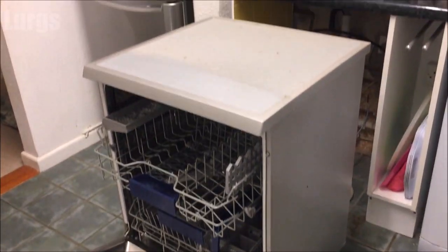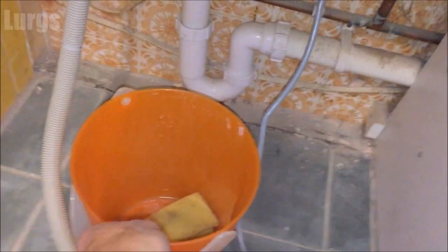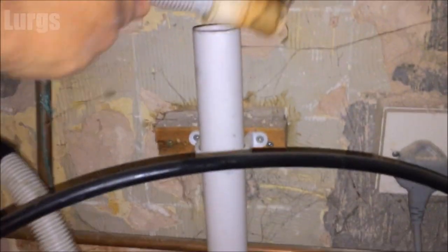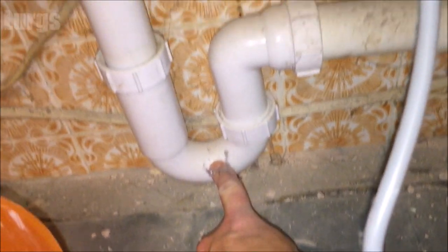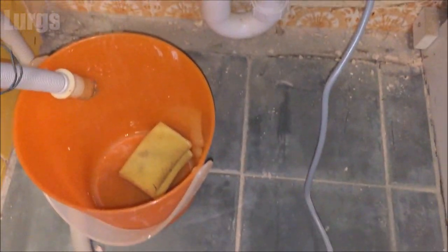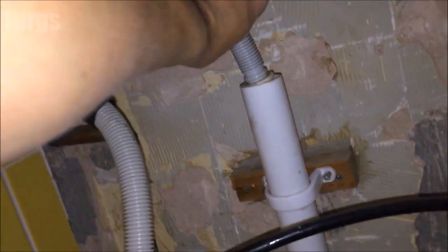Now I'll show you some slightly different drainage pipework. If your drainage pipework is at the back of your dishwasher, you may need to pull it out — but be careful, because you've got a cold water feed and your drainage hose, which might go into pipework on the back of the wall. Make sure you've got your bucket ready and check for any sludge in the drainage pipe. To save taking all the pipework apart, just take your phone camera, set it to video with the flash on, and video down inside. You can see if the water looks clear or if it looks sludgy and horrible — that would indicate a possible blockage.